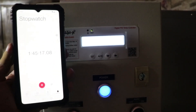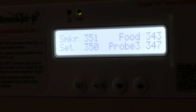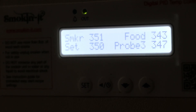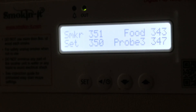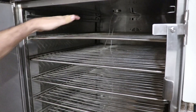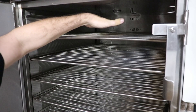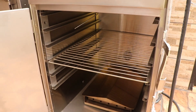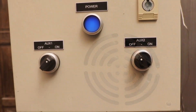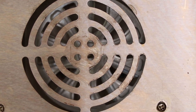Through the power of editing, an hour and 45 minutes has now passed and it looks like we are at 350°F — which is what we set it at. Both probes are reading fairly close: 343 and 347. I felt like that took a little bit longer than it should. Let's open it up and see how the fan is kicking — I'm not really feeling a lot of hot air blowing at me. It doesn't feel like any air is moving whatsoever. The fan should be spinning right about now and it is not spinning.